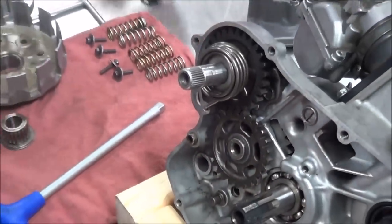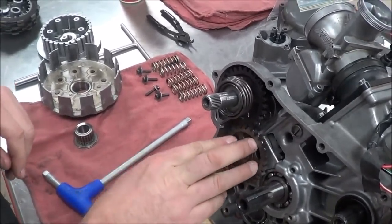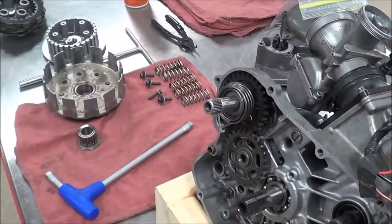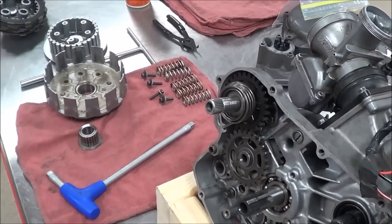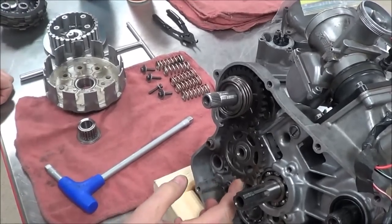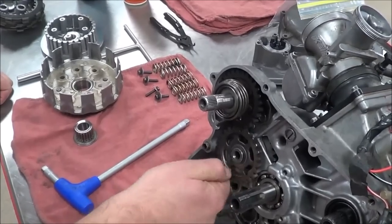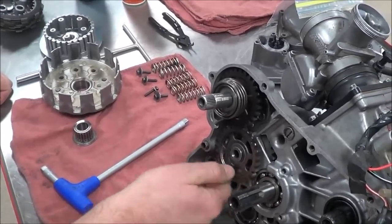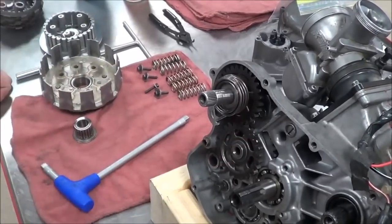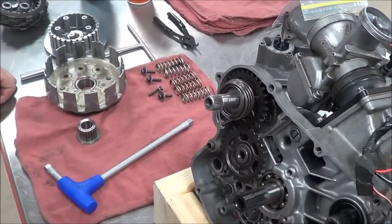And we could look at the microfiche to verify that. Verify that as well. I have a question about the idler. Is the name idler gear used for any gear that links the Kickstarter to the actual spinning mechanism parts of the engine? Or is an idler gear a name for a gear that's always just free and linking other parts? I would say by definition, it's a gear that is just rotating around a shaft. It doesn't drive the shaft. Yeah. It drives a connection path between a set of gears.